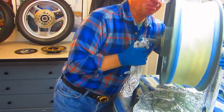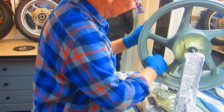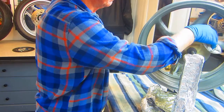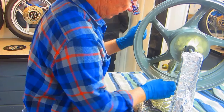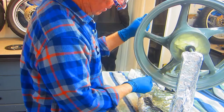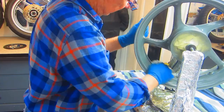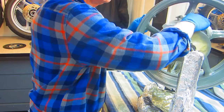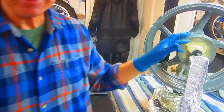Now I have to get on the next coat of primer. I want to clean off all this — it's all got soapy water in it. I'm confident I've got this sanded and detailed as much as I can for this coat. If the next coat of primer goes on nice, we'll be ready to shoot some silver. The key thing to be careful of is not getting a lot of paint on the edge — minimum paint on the edge — because even putting tires on without tools, I don't want a thickness of paint there that peels or chips. Up around the hubs and spokes we're going to try to make this look like a piece of jewelry.